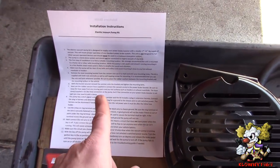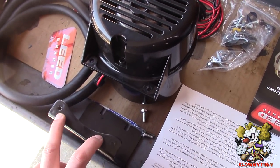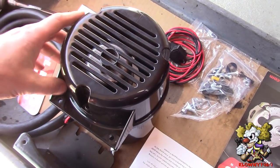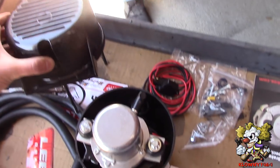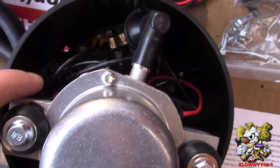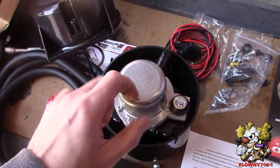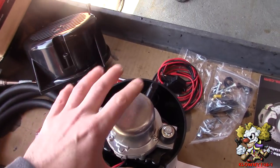This is the bracket that comes down here — I took that off. There are two 10mm bolts on top and two on the bottom; the bottom ones you can just slide off. You can see how it's notched over there. There are four 5-millimeter allen-headed screws and that comes right off. This is the Bandit now naked. You can see inside: you have the relay, the pressure switch down there, and it's all wired up and self-contained. If you don't have room you can just buy the naked Bandit, but if you do have the room you can buy the whole assembly.